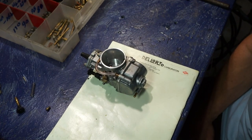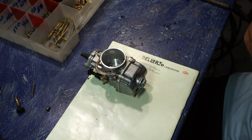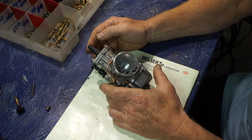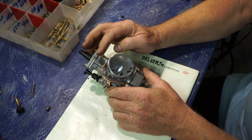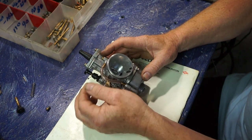We've got a bit of a conundrum and we're going to get a solution. We've got a mountain man who lives 2,500 feet above sea level and his bike doesn't run very good at that level, but it runs fine when he comes down to the coast, which is 20 kilometers difference. 20 kilometers back up the hill and his bike runs awful. We've fitted a dynajet kit, but the power jet is overpowering the dynajet kit and stopping it from working because it's supplying too much fuel.